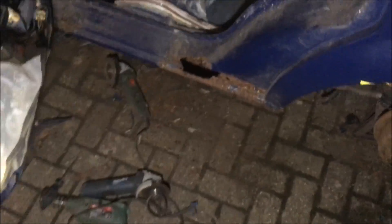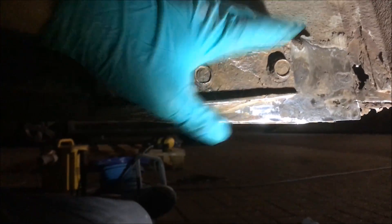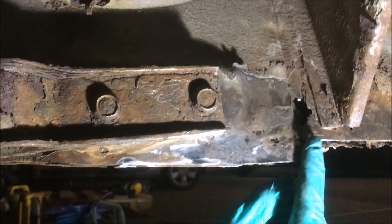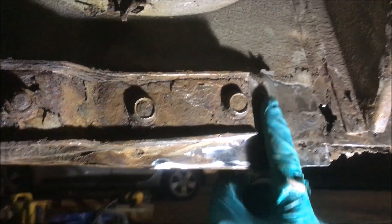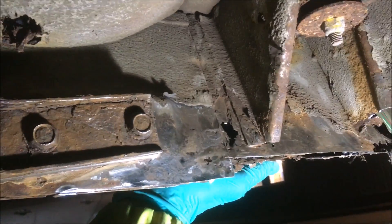In here you can just see — hopefully if I can get the light right — two captive threads. Those are for the trailing arm, and that is the crucial area on these cars because replacing that is a real ball-ache; I've done it before. Those two captive threads are on the back side of there, so this has to be good metal or it's quite an involved repair. Unfortunately, you've actually got three panels coming together here: this big chunky steel at one and a half to two mil, then the inner sill which is the continuation of that, and then the outer sill — they all come together.